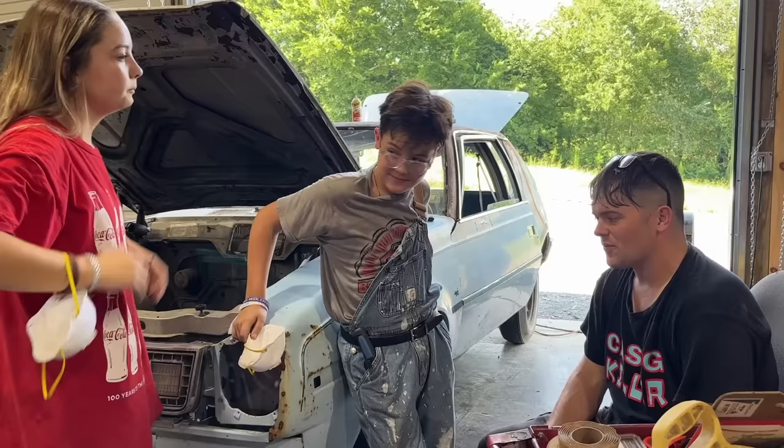Wawa decided to start sanding the roof because it's completely rust — she's using 80 grit since she's just sanding metal with no paint. We're going to have to primer that for sure. The master cylinder didn't come with the other half of the push rod, and the instructions don't mention it either. I'm going to have to cut this one off and either weld or bolt it together. I need to get a measurement on how long this is — looks like six and five-eighths inches to the center of that hole. We've got electricity, so that'll speed it up.